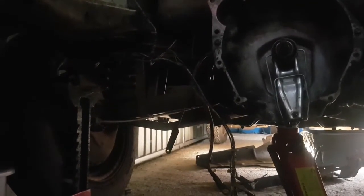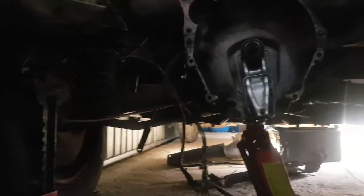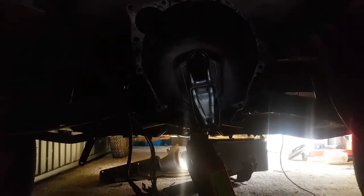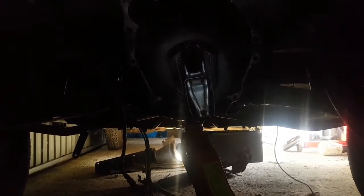I've just had a really clever idea. I'm not sure if it's going to work but we'll soon find out. Basically I was going to try and get something on top of the jack to sit either underneath the bumper overriders or the chassis legs, but I've had a better idea. I'm going to put the actual stands below the chassis legs both sides and lower the whole car down, and if the body happens to hit the top of there first, it will lift it above the axle as we need it to. If not, it's closer to the floor and we can get a jack underneath it easier anyway. Fingers crossed it'll work.